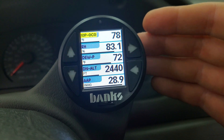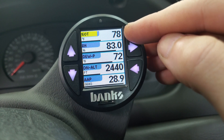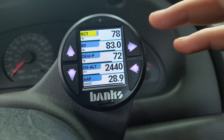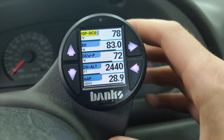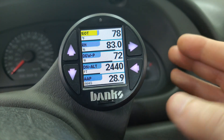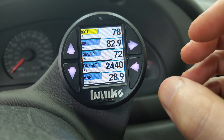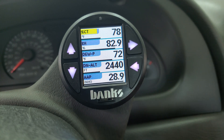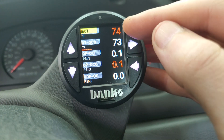This page is all air information coming off the Air Mouse — ambient air temperature, relative humidity, dew point, density altitude, and ambient air pressure. There's also a ton of additional functionality. The Air Mouse can calculate SAE testing standards versus ambient air conditions, so on a cool dry day it can correlate your current weather conditions to an SAE testing standard, telling you how your ambient conditions compare.